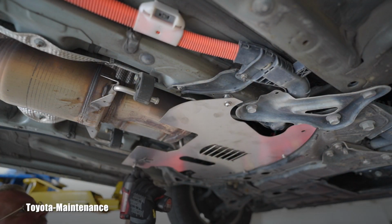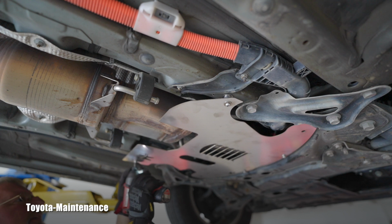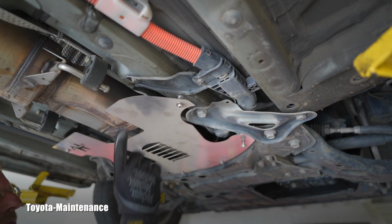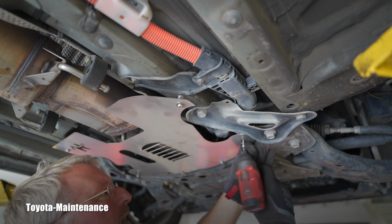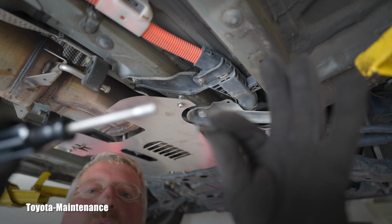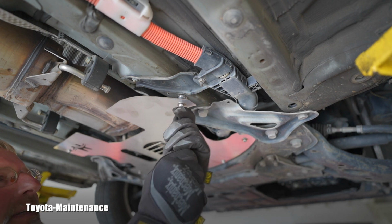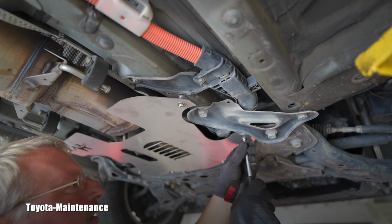What about this one? So first engage the tool. Only after that you start up. And again, I'm still not torquing it to the max. I did mark it correctly because all six bolts can nicely go in. So only after that will be the time to start torquing it. And that power tool just did the fast work. Right now I install this special tip in this screwdriver handle and I will go around feeling it properly and start torquing it so I know it will not strip or anything like that.